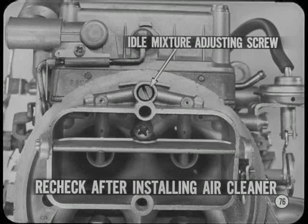On the early production models, the idle mixture adjusting screw is in the air horn. This means you'll have to adjust the idle mixture with the air cleaner removed and then recheck the idle mixture and speed after installing the air cleaner.